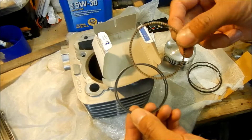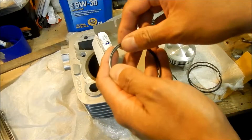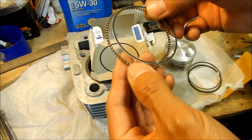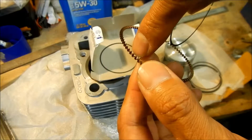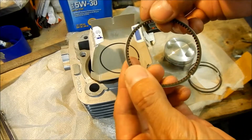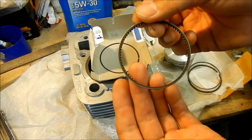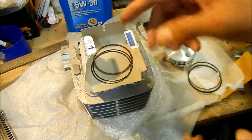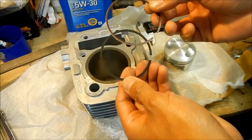So azomega's been watching a lot of YouTube videos about engine building, so I'm going to impart my knowledge. When you install these on the piston, you want to make sure the piston ring is seated outside of the little seat, kind of like that, and you want it to be able to rotate in there when it's on the piston. So those are the oil rings — I'll put those separate. And these are your actual piston rings — these are the ones that hold the compression.